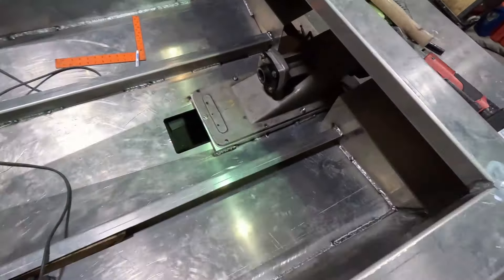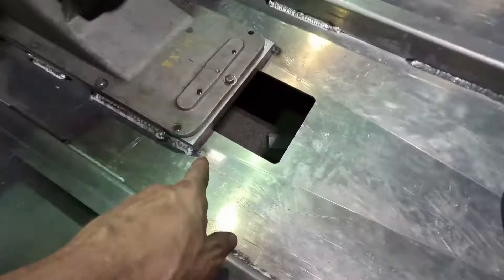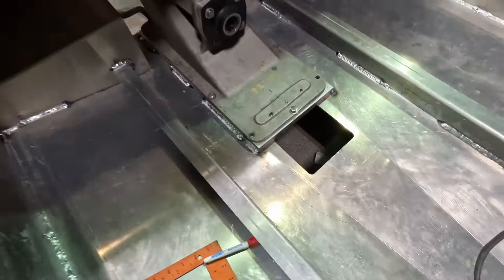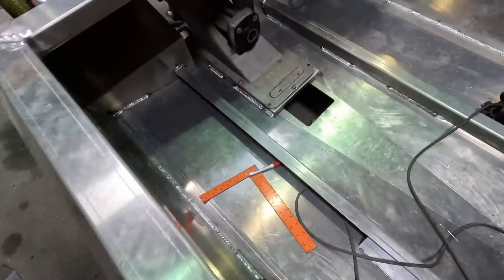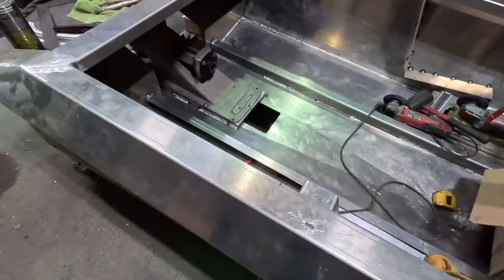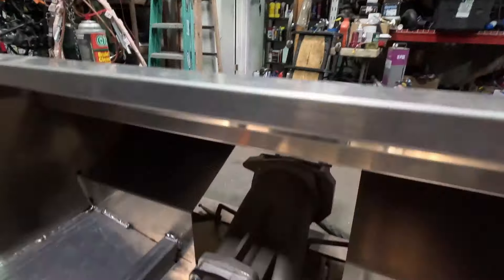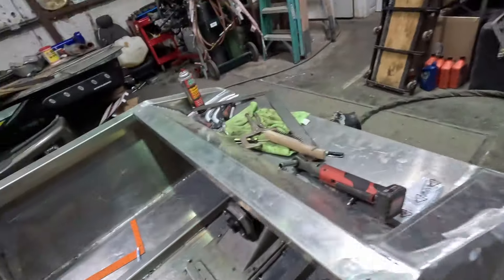Many, many hours of grinding and fitting and measuring and cutting and all that stuff. We have what we call the jet block tacked in and centered up — that is awesome. We're going to finish welding that out, cut out the center, patch up that hole right there. Next in the video: put the engine back in, get it kind of where it needs to go, start building motor mounts. After we build motor mounts and seal up this area, this boat will float. Just hook up a couple things on the old two-smoker — they're super simple. We are at least getting the first lake test in.